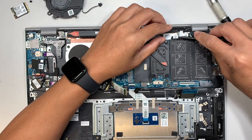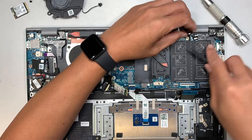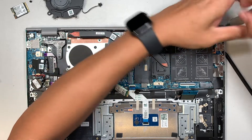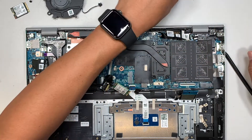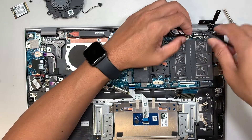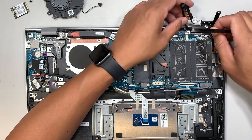Now we're disconnecting the LCD screen cable. Open up the clip and slide out the 40-pin connector. The webcam cable needs to be slid to your right, but first remove the hinge screw — it'll be easier to flip the hinge open before disconnecting the webcam cable. The cable is somewhat stuck down, so you may need to carefully pry it open to disconnect it.